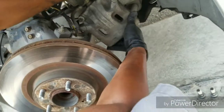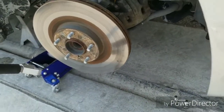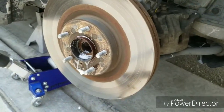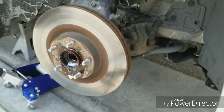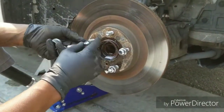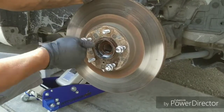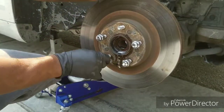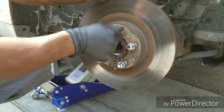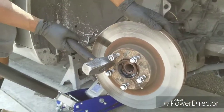While he's holding the camera, I'm gonna go ahead and knock that off. And what I usually do, spray a little bit just to get a little soapy water. Grab the lug nut, thread them on a little bit. You don't gotta put them on tight, just to protect the first couple threads, because those are the starter threads. You don't want to mess up the starter threads when you can't get the lug nut back on. So just thread it on a couple. Then you get the hammer and start wailing. Give it the Thor power. Yeah, the hammer of Thor right here.